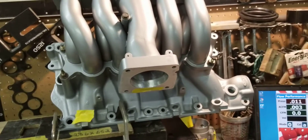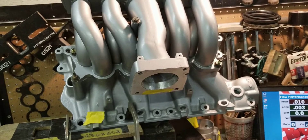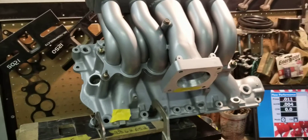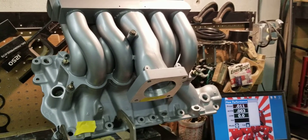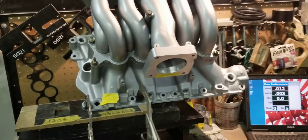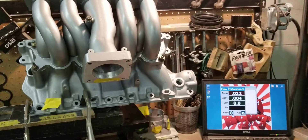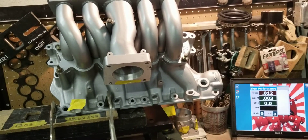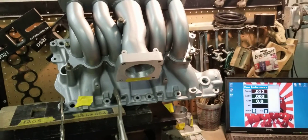But you've seen it here. Stage 3 tubular on a 351 Lightning lower — it did about 315 to 320 on the number 4 runner. You can see this and other examples of our porting on our Facebook page and YouTube channel at BigDogsPorting. See you guys at the track. See you guys at BigDogsPorting.com.